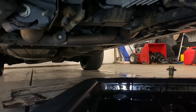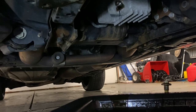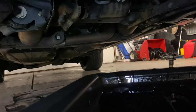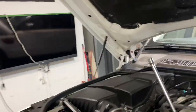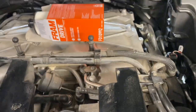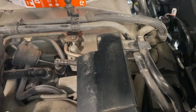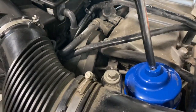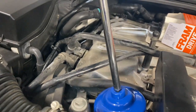The oil is draining out now — the oil drain plug has been removed with a 13mm socket, which you can just see there on the end of my capture pan. So that's draining away nicely. We're also going to get back on top of the engine and remove the oil filler cap. The oil filler cap is located to the right, just by the right-hand side air box. This is the 5 litre supercharged so it's got air boxes on both sides. And then the last thing we've got to do is remove the cap for the oil filter.